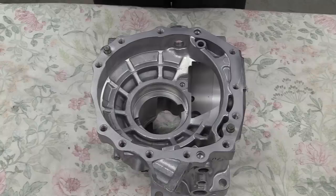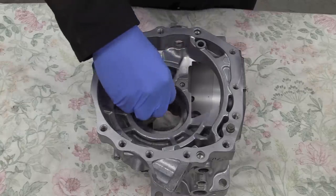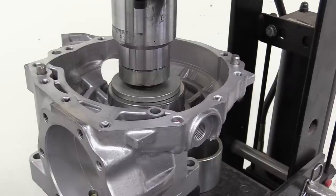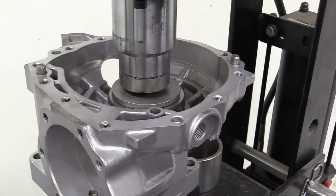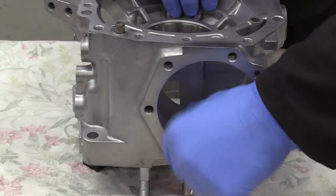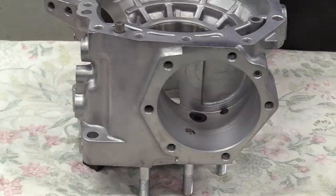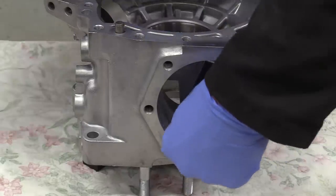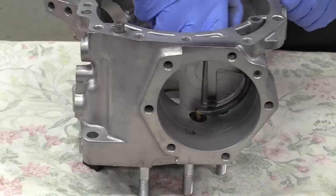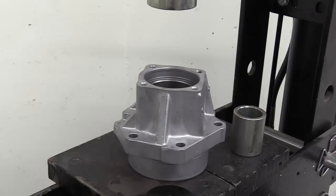All right, I'll start with the transfer box and reassembly thereof, starting with the bearing shim and bearing race. A little rubber cushion for the oil transfer tube, followed by the tube itself. Need to put the two outer bearing races back in the pinion assembly.